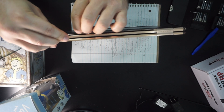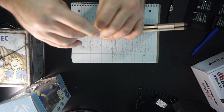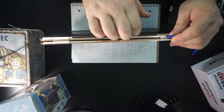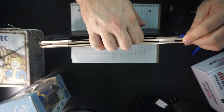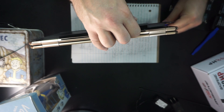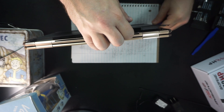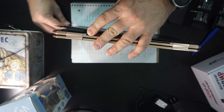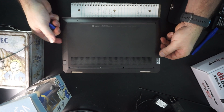Right now I'm taking the little pick spudger tool and pulling right where the hinge is, because there's a gap where the hinge is. Then I'm running that tool gently across the rest of the frame so that I can basically undo the clasps inside that are holding that thin piece of metal back covering. You don't want to bend it, so you want to start with the hinges because that's where you can get that little plastic tool inside, and that will allow you to pop the clasps and get into this machine.